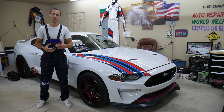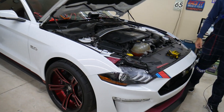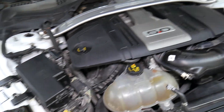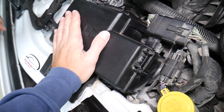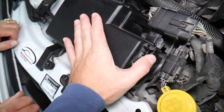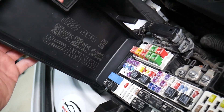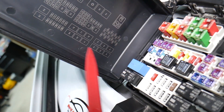So let's start. Specifically, we have a 2015-2018 Ford Mustang GT 5.0 here, but even if you have a different engine the procedure will be about the same. This is your main fuse box — the engine management fuse box. To open it, press that notch and lift up. On the back side of the box you will have the fuse numbers and relays printed right here.